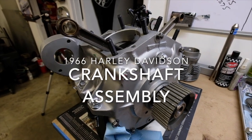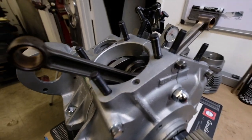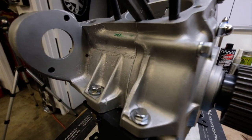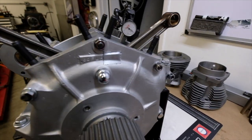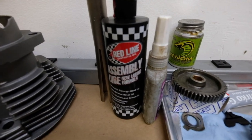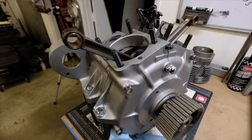The cases are together now - the crankshaft assembly is in the engine cases and the studs are all fully installed. It was too difficult to film the process of installing the crank, so I skipped trying to video that. I did run a bead of silicone all the way around the cases before joining them, let that cure for a few minutes, then joined the case halves and put the crank in. All the bearings were heavily doused in assembly lube, and it's now fully assembled on the bottom end with all studs torqued to spec.